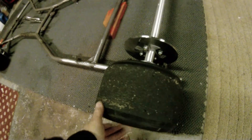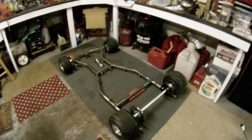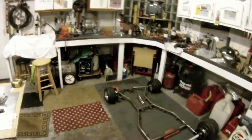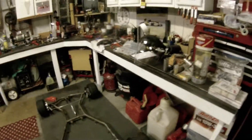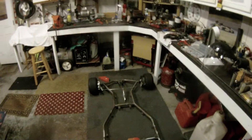This just barely spins, but these tires don't have any air in them because I only had two valve cores and I needed them to get the front pressured up and set up right. These little 450 tires — at 15 pounds, granted it's freezing cold out here — they only measure 30 and three-quarter inches in circumference. I'm used to everything on the front of my car being 33, 34 inches.